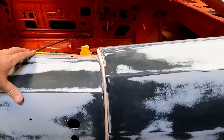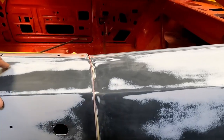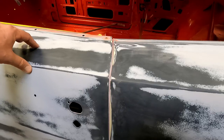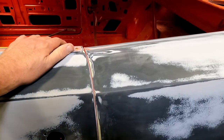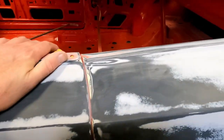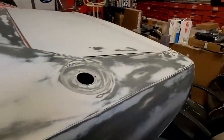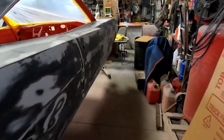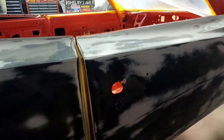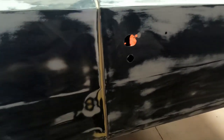All right, something else I like about the foam, probably for primer and all that, it makes a nice little soft close as it goes perfectly where it's supposed to land. For priming and panel matching, when you get these two super tight and are bondoing, it won't slop all in the inside if you're trying to get this perfectly panel matched like I did on both of these. It looks like it just shuts and lines up the door perfectly. Pop says you got that nice soft closed door. But yeah, that should do great.